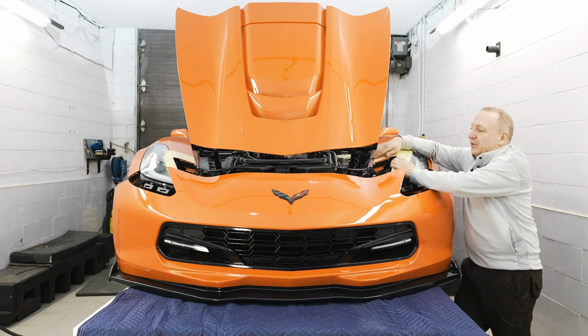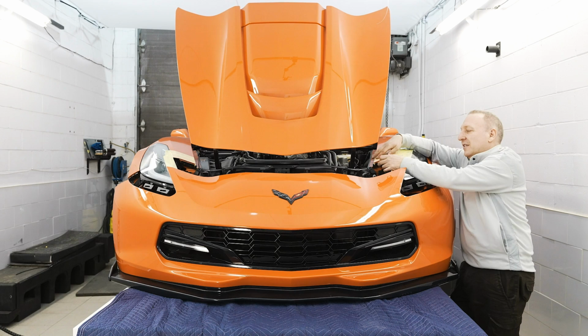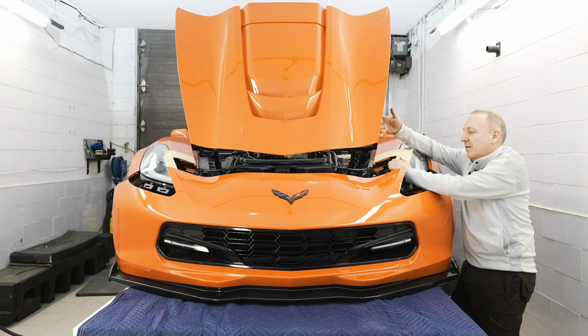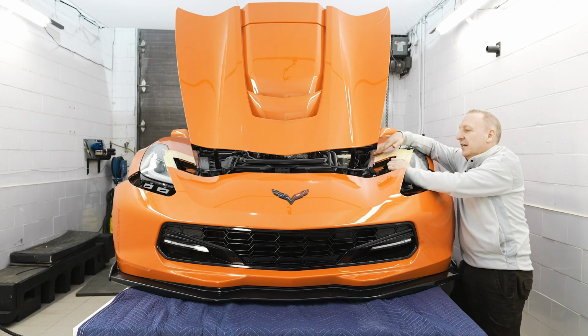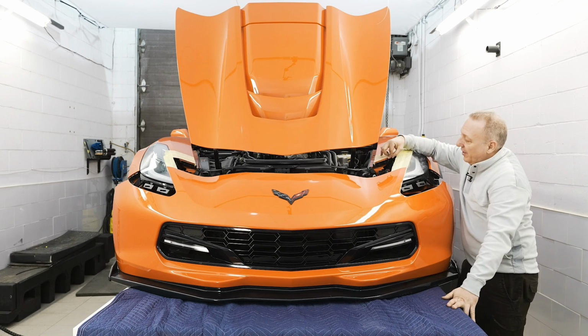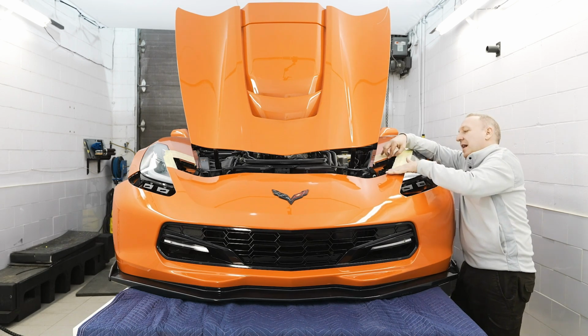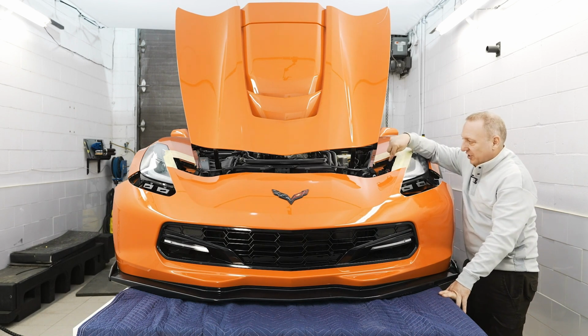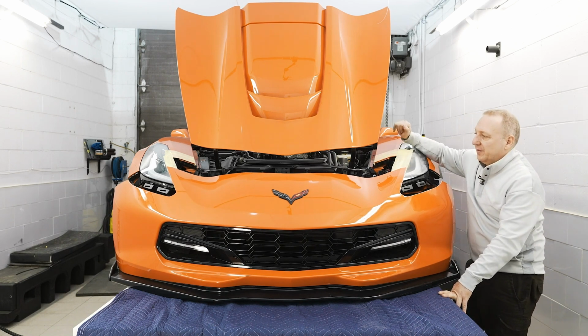So if ever you wanted to service the car a lot, you would loosen these up, except you don't have access to these. So if I knew I had to take the bumper off tomorrow, I'd probably loosen it off today, but it's a permanent install. We never touch these, we leave them where they are. They are tight, but as we tap on this area here, the little square tabs will engage, and that's what basically gives you that nice seam up here.